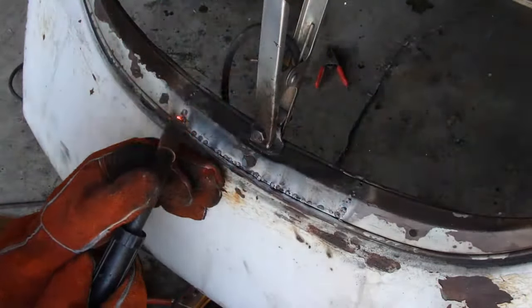But in the grand scheme of things, it's more solid. It's better. This is unsecure. Looks a little bit more to the right, like it should. It's not rusted out underneath. I'm going to probably use a teeny bit of body filler, as I said, just to cover up some of these little pits and things. You don't want it to be too structurally thick here, so that when the lid comes down, boom, it cracks the bondo. But right now, just to show you.